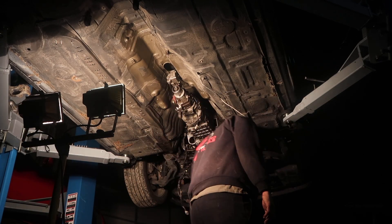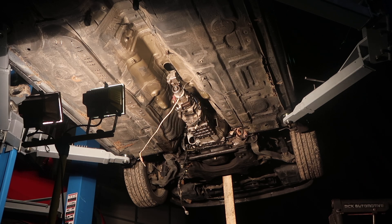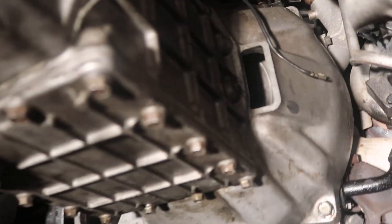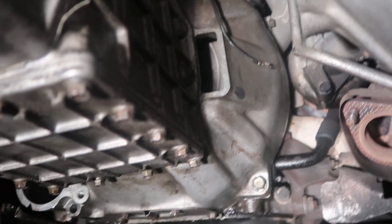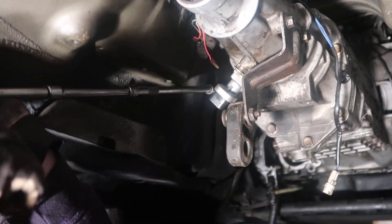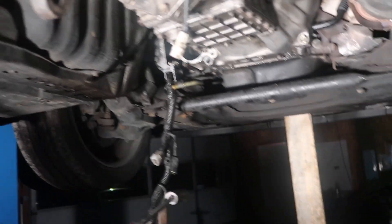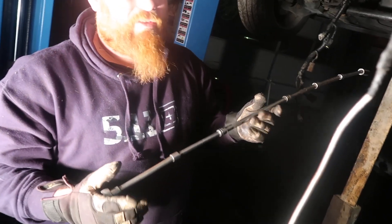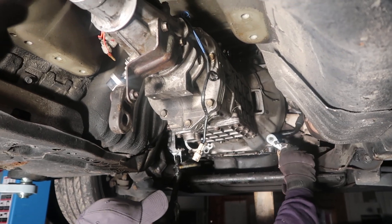It's a miracle! That input shaft had the transmission all messed up. I think somebody said the pilot was wrong. So the issue was the input shaft was ballooned out just ever so slightly on the end. After we machined it down a little bit, it slid basically right in. Right now we're tightening some of the housing bolts just to get it flat and flush with the engine. Once we get it flush, we're gonna make measurements from the back of the output shaft to the differential — send it off to the driveshaft shop. Holy shit, there's a transmission in my car!